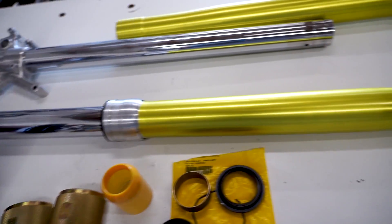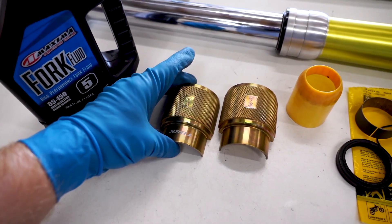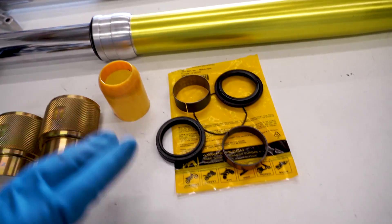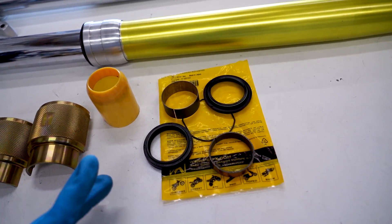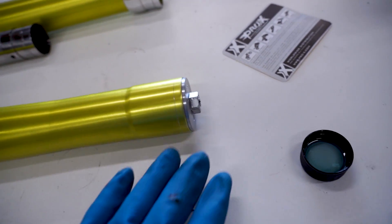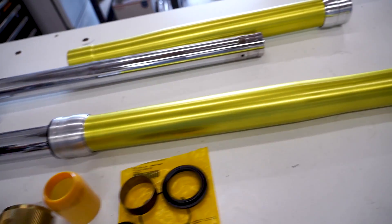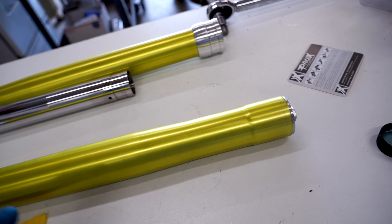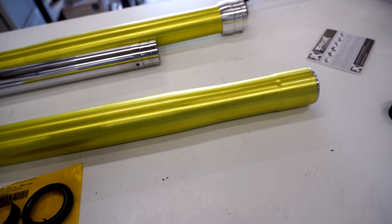The right fork is completely done and ready to go on the bike. Here's everything I used for the rebuild: Maxima 5-weight oil, a Tusk seal driver set, a seal bullet, and Pro-X components for the bushings and seals. I'll have all this stuff linked down below in the description. One thing to keep in mind with pretty much any brand of fork rebuild kit or bushing kit - you don't always get the seals or o-rings for the fork caps or the fork bottom. This kit didn't have them, but luckily all the o-rings were fine. Typically those really aren't wear items, which is probably why they don't include them. They are pretty easy to come by though - you can get them straight from Suzuki as an OEM part, or Rocky Mountain carries them.